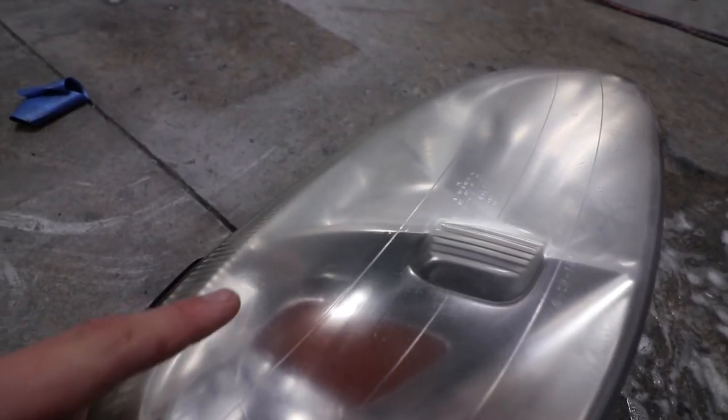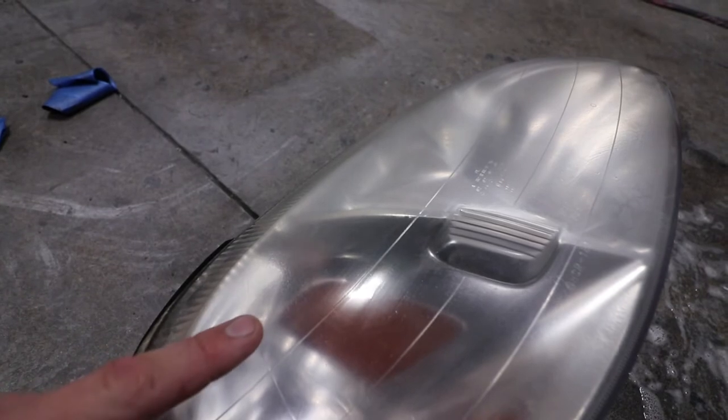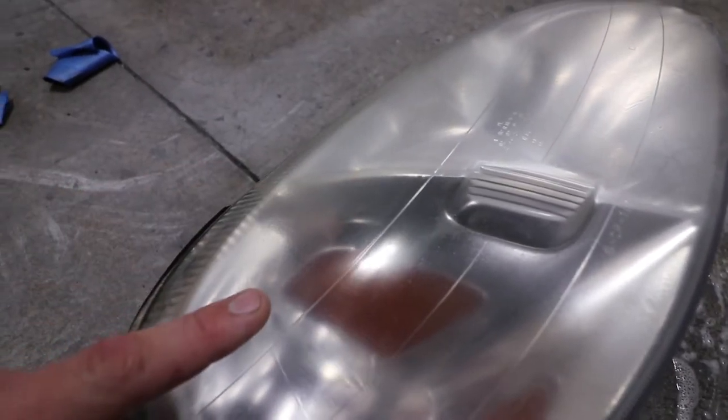Unfortunately last night didn't go completely as planned. I started clear coating the headlights and ran into an issue on the first coat. I've already started sanding this down, but I wanted to show you - you can see right here the clear coat actually failing. It almost looks like crow's feet - the clear coat was actually cracking. That could have been caused by multiple reasons: not having a properly clean surface, I ran out of solvent and used an alternative cleaner, or the clear coat was applied too heavy on that first coat. You have to re-sand it all the way back and clean and prep it properly, then re-clear it.